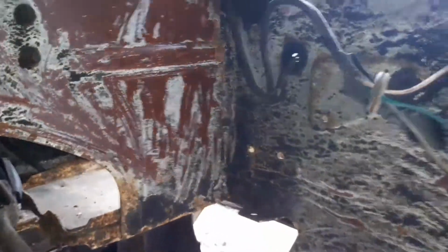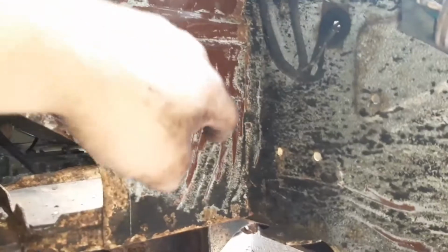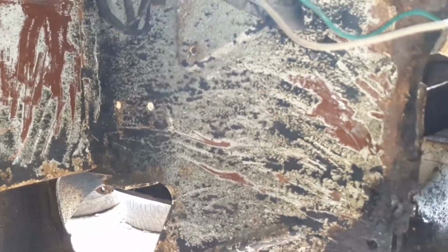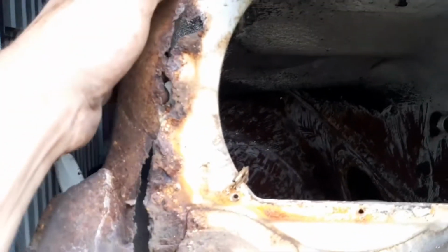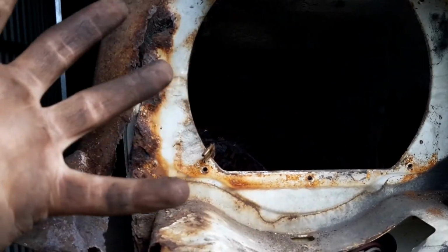So what we're going to end up trying to do is, I've spoken to a few contacts already. I'm going to try and get hold of a complete headlight panel for this side, which basically involves drilling all the spot welds out around this edge up and around the side, purely because it'll be simpler than trying to repair this one. I say that because if you look into this edge here, you've got all the multiple little layers just blowing apart, and unless you properly go all the way into that and start pulling it all apart and repairing it from scratch, you're not really going to end up with a good panel that's rot free. So I'm going to try and get hold of a donor panel that's solid and rust free in the first place, so we're not worrying about the fact that there's going to be rust inside that's going to blow back out later on anyway.